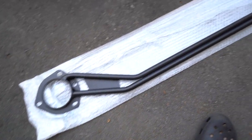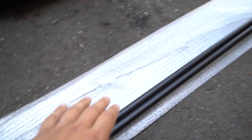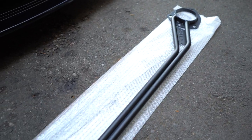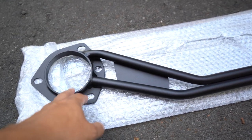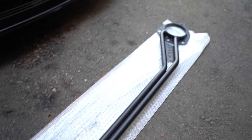Quality of the strut bar is absolutely fantastic. The welds and everything are really good. What I really like about this is it's not like those three-piece design strut bars. It is a tubular design — it's solid, there's no flex, no play because everything is welded. That makes the biggest difference in stiffening up the car. Some hollow strut bars don't do much — they're more aesthetics — but this I think is actually going to do something.